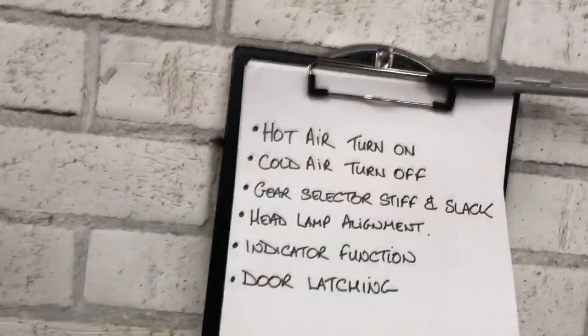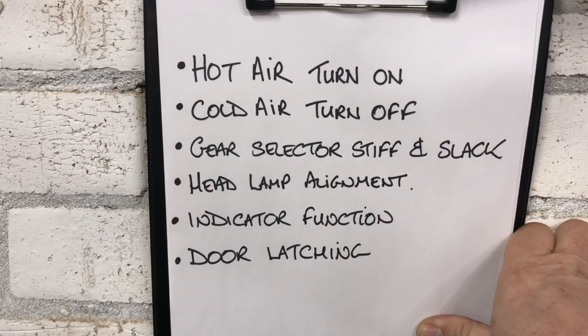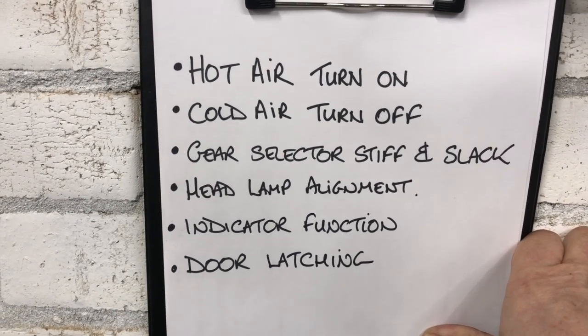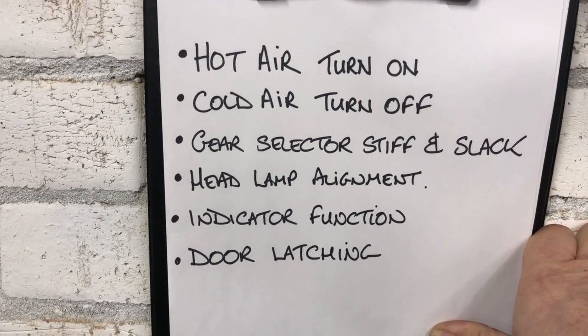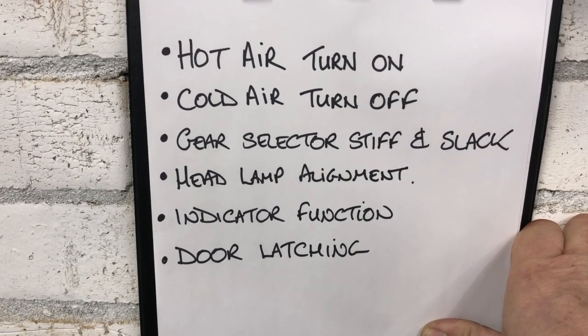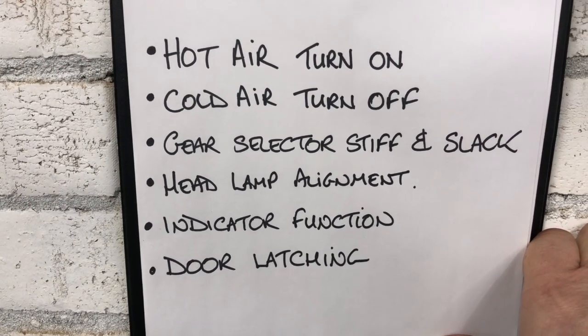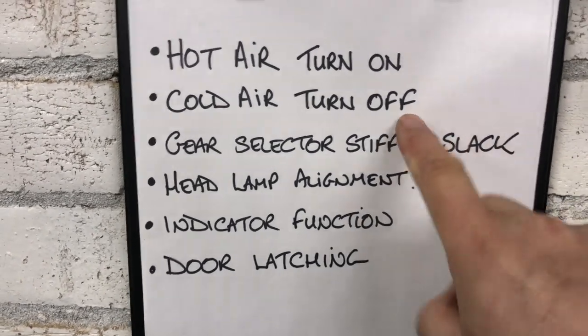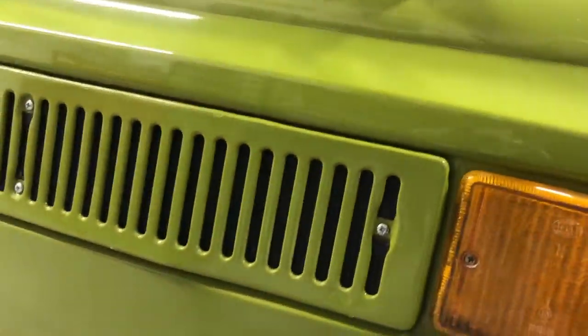If it looks too good to be true, it is. This I'm completely happy with because it's completely honest - I know what this is and we can do something about it. So here's my clipboard. These are the more mechanical things that went wrong or were identified on the trip back. Hot air: there is no hot air making it to the cabin - just the faintest waft on the demist setting. The demist setting invokes the little fan in the engine compartment which wafts some air forward, but even by T2 standards it isn't working. You cannot turn off the cold air that comes through the grill on the front and it was freezing.